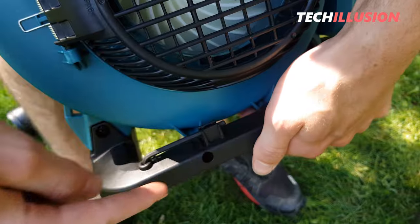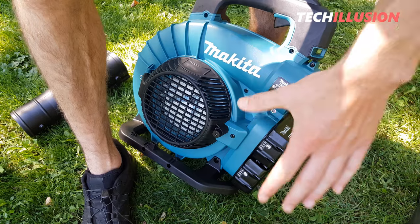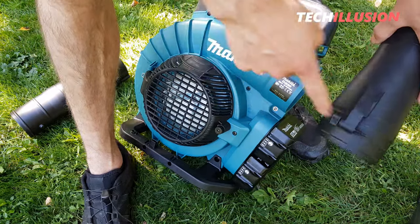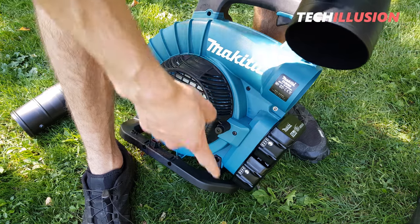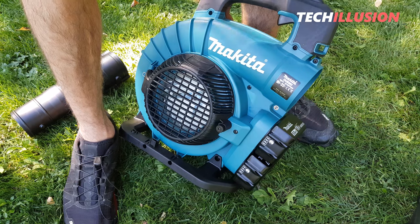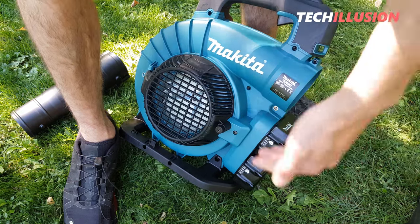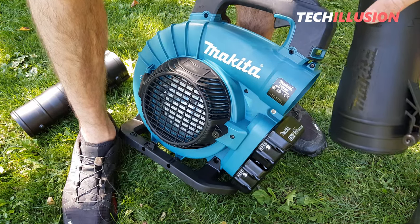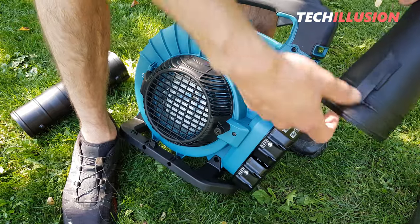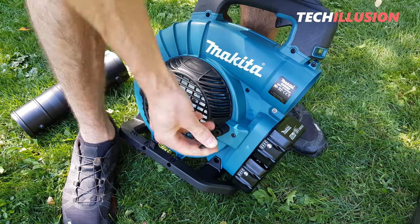Fortunately, we find a small allen key at the base to loosen the screw if needed. Also note that the leaf blower cannot operate if you haven't properly tightened the two screws on either the blowing tube or the cover of the fan wheel. There's a mechanism in place that detects whether the flap is open or closed, preventing accidental hand contact. Initially, I searched for a long time wondering why the leaf blower wasn't working because I hadn't assembled the blowing tube — so always make sure to tighten the screws properly.